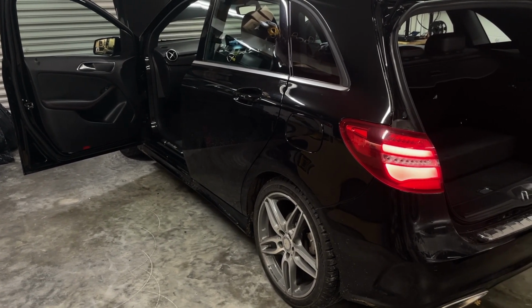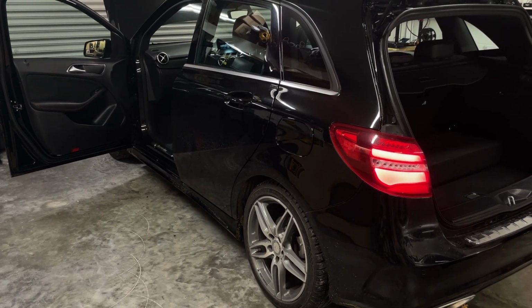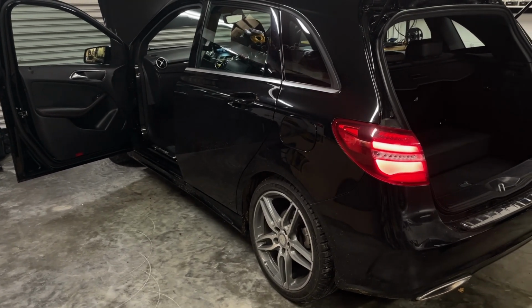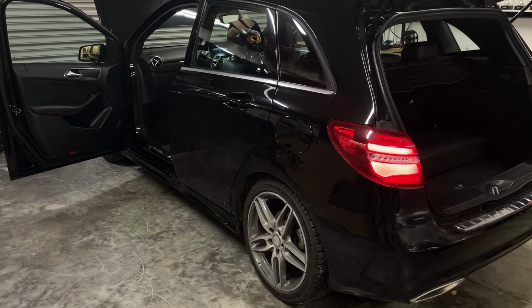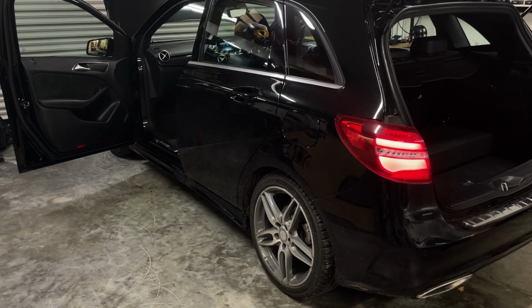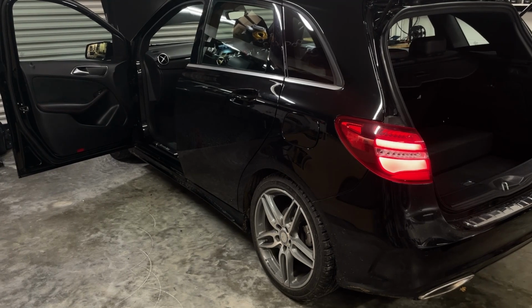Then seats have to go back, plug them in so you don't get any fault light on the car, any airbag lights. Or if you have OBD and you can clear it, happy days. But we don't have OBD for every single manufacturer's car. So yeah, it's a lot of faff, taking seats in and out, and all that. But it's been done, and you saw the daily updates.